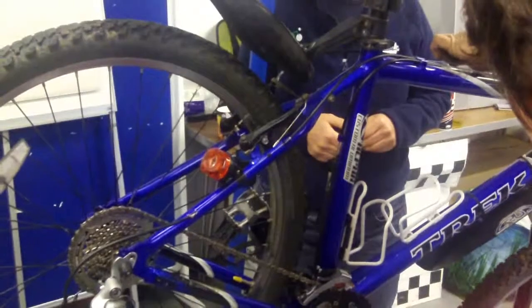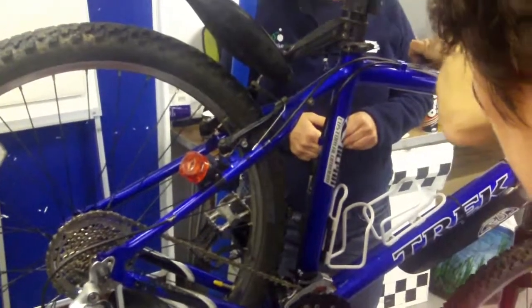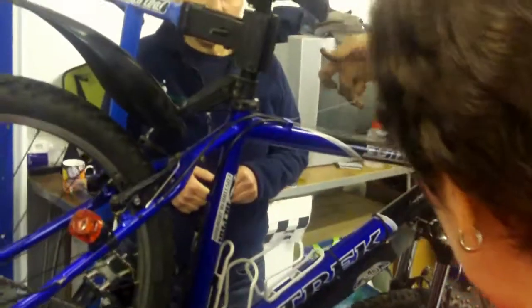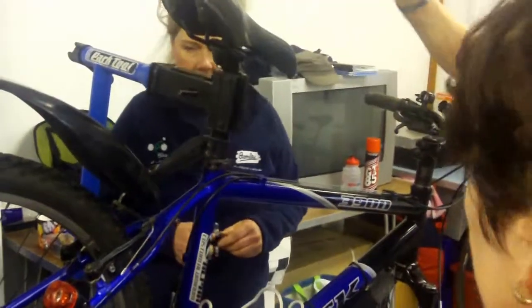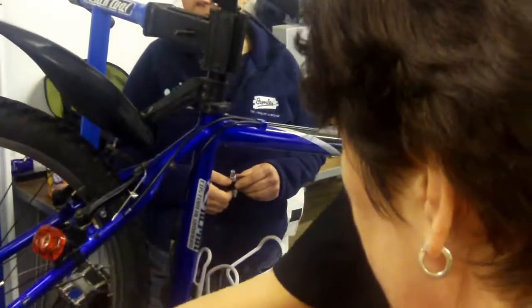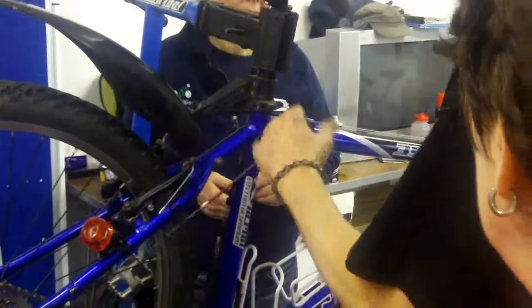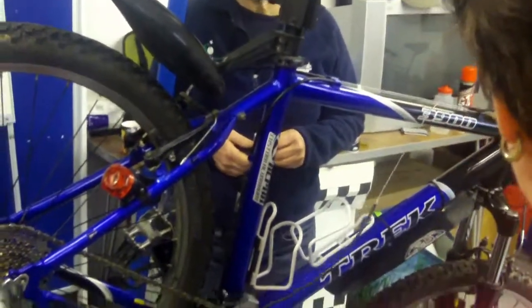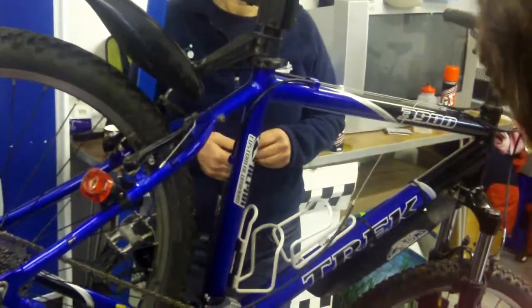and just tension it a little bit. Like that. You've got, the cable's gone slack, and it'll stay slack, because that's jammed on there. And then you can undo all the cables, like this. Take them all off like that, and you've got a cable sitting there that you can lubricate much easier.